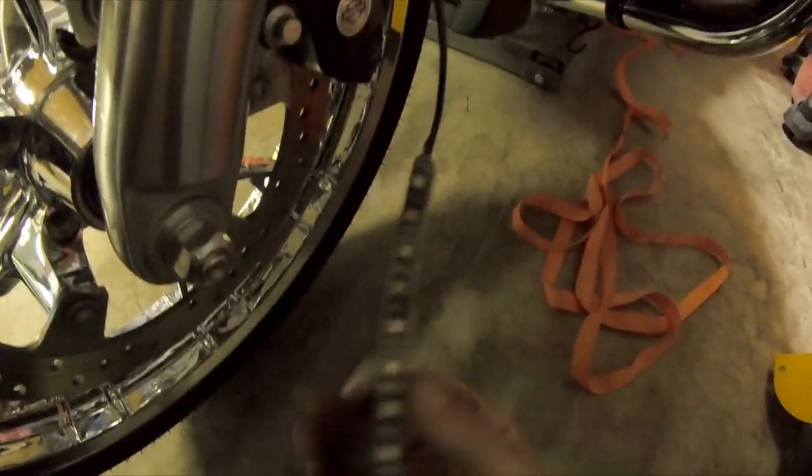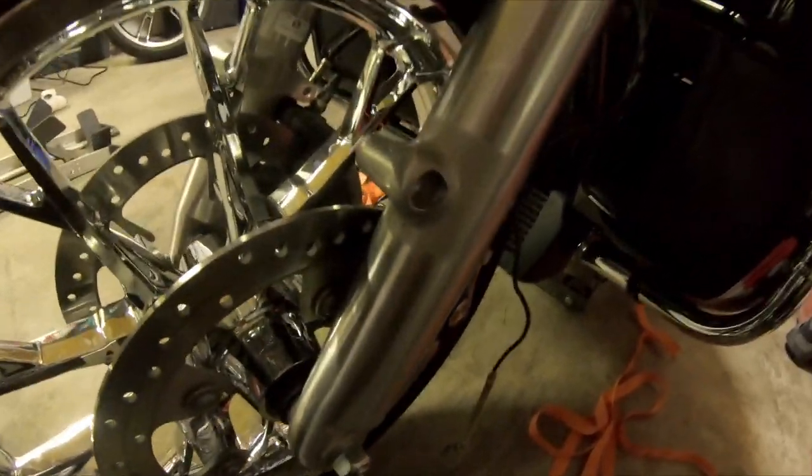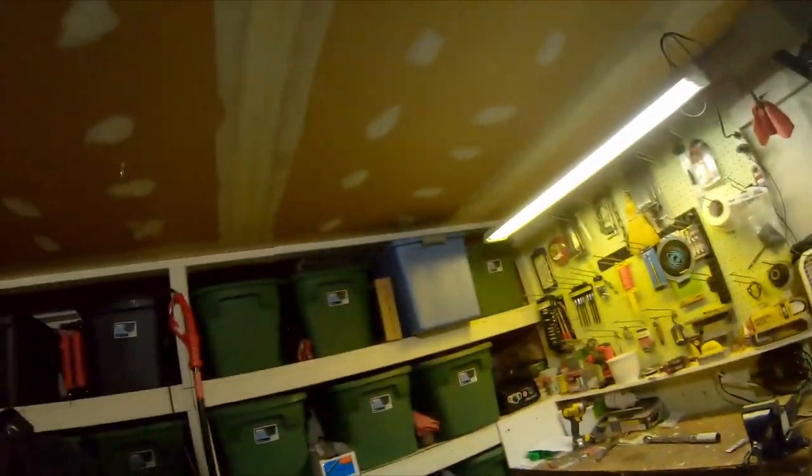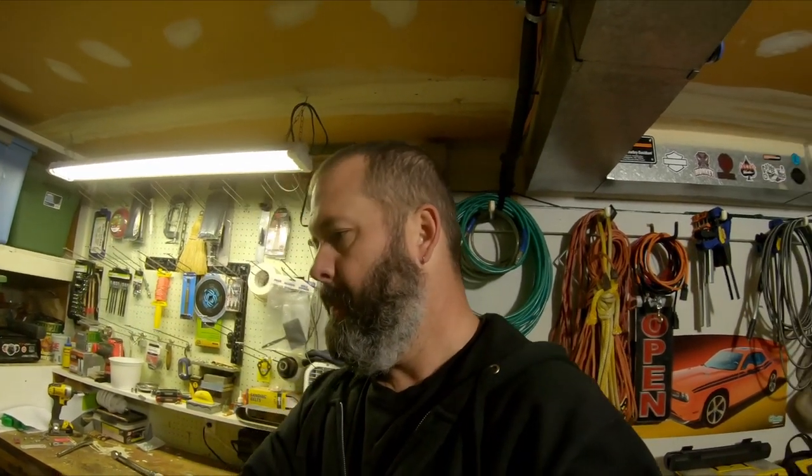Also, make sure that hole in the axle is facing forward — if it faces straight up and you don't have axle covers, you'll get a whistling sound as wind whips past it. I faced it forward because that's how it was, and I have axle covers going back on anyway. So I'm going to torque down both sides and the axle nut. Looking good — really digging that 21-inch. I know it's still up in the air, but that looks clean. Going to button this up, get the fender on, get it risen up, and call it a night. Tomorrow we'll tackle the rear wheel — it's more involved because of the belt, but that should be a good time.